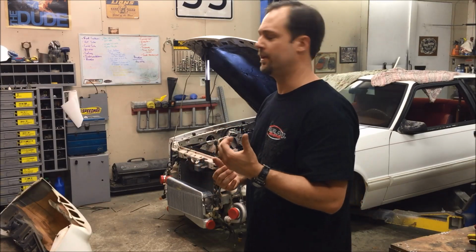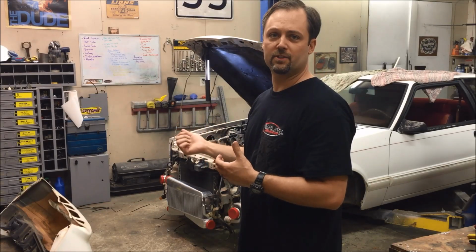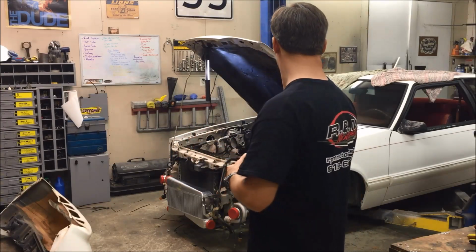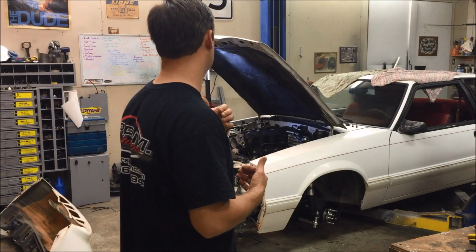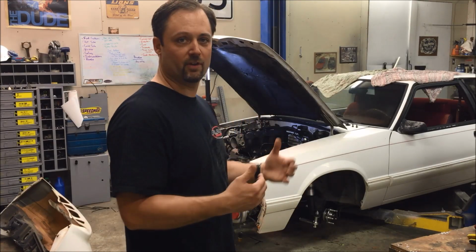Next couple steps, probably in the next video. The front bumper cover does hit the bottom of the intercooler, so I need to trim that front bumper cover. The hot side, between the exhaust manifolds and the turbo, that's probably the next big step. That stuff's all ready to go. I'm really looking forward to getting that piping done, and getting the turbos locked into a position where they're going to go. So that's going to help everything else kind of move forward. There's a variety of other small things I need to do. I need to put the brakes on the car, the injectors, the fuel rails, some other stuff like that. But the next video, we should be trimming that bumper cover and hopefully finishing up the hot side.